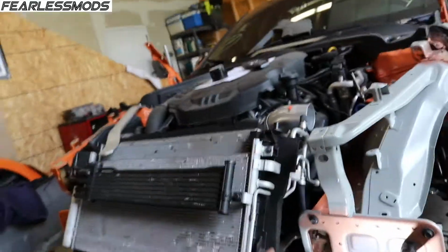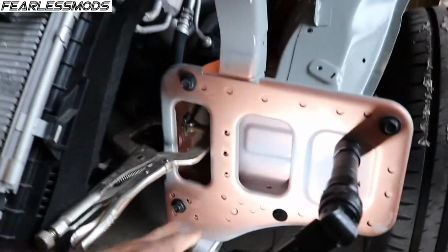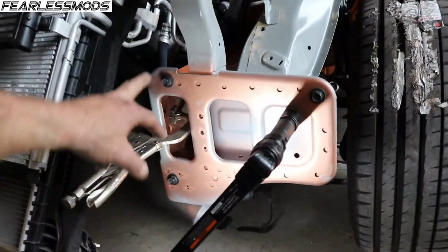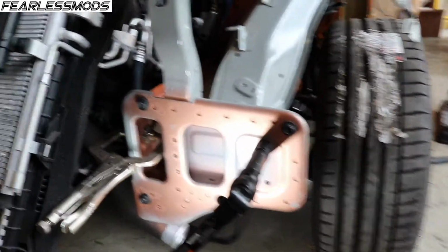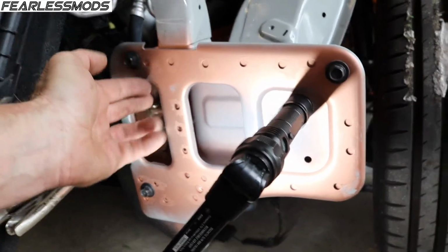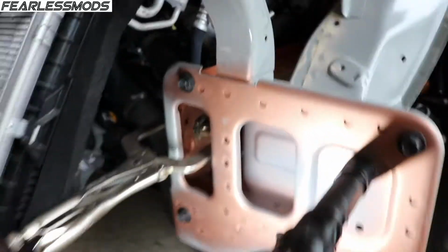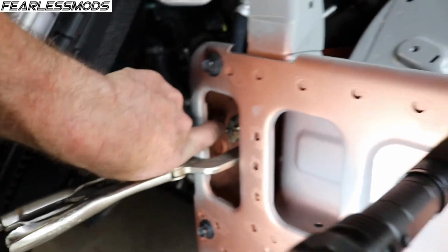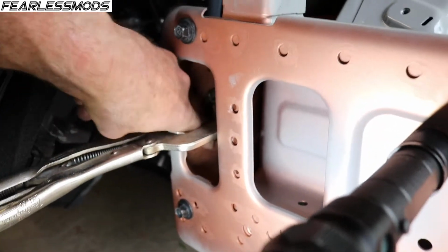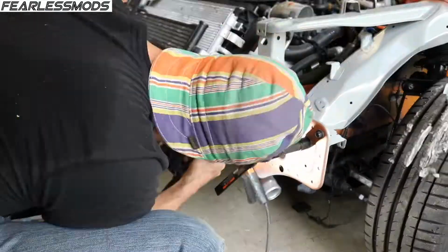So we've got the 25 holes drilled out right here so we can put our spot welds in. A little bit of alignment still needing to occur with the bolt holes, but these are going in just fine. What I'm doing first is just going ahead and getting this mounted to the inner frame. So this is where I'm going to have to go in here and weld these. I want to do them from the inside here. Got 6 spots here, one's covered up, but those 6 spots right there, I'm just going to weld them from the inside here.